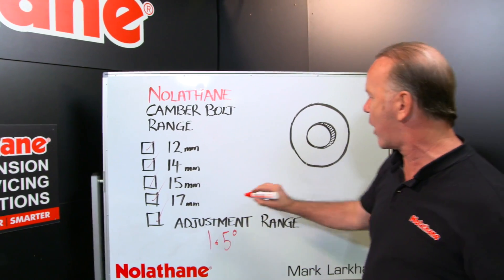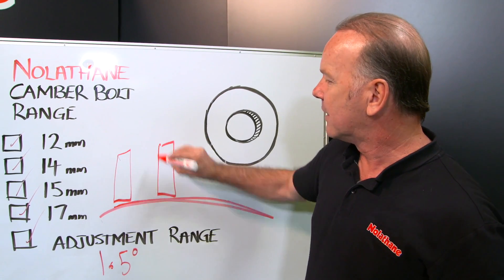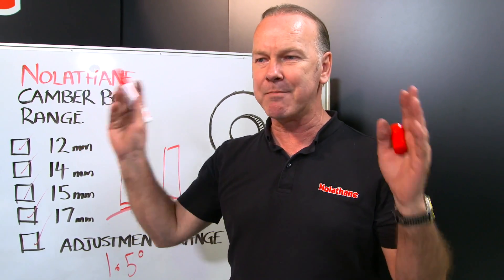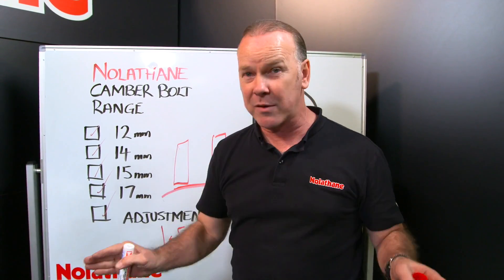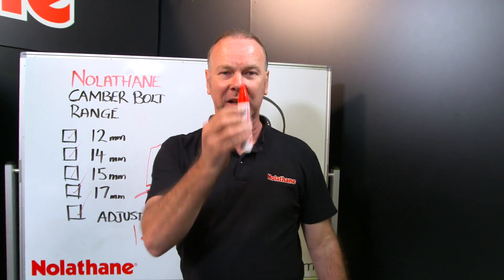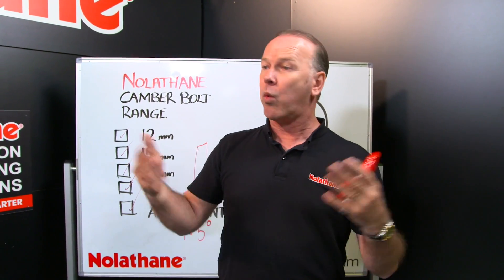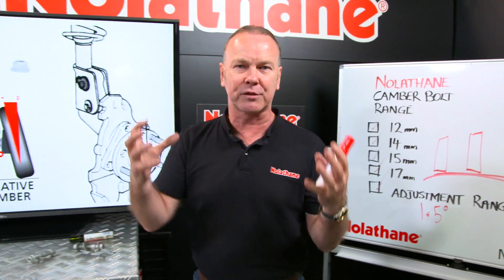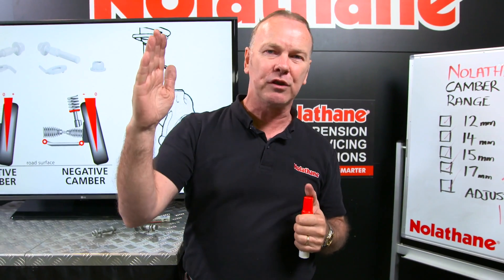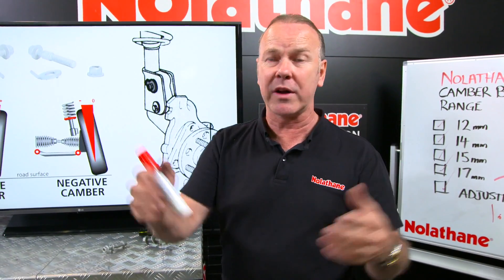Let's go through a few reasons. When we talk about a roadway in Australia or anywhere in the world, they're all sloped so the rain runs off — it's safe — and your car tyres sit at an angle. Depending on whether you're left-hand or right-hand drive, do you really think a manufacturer sending vehicles all around the world would have the camber settings right for every country? What about after an accident, or when the torsional rigidity of the car moves around? What about inferior aftermarket products, or a car after 10,000 to 15,000 kilometres when all the suspension and bushings have settled into place? It only has to be 0.25 or half a degree out and it will have a bigger impact on your tyre wear than tyre pressures, toe out, or toe in. Camber is right up there with tyre wear.